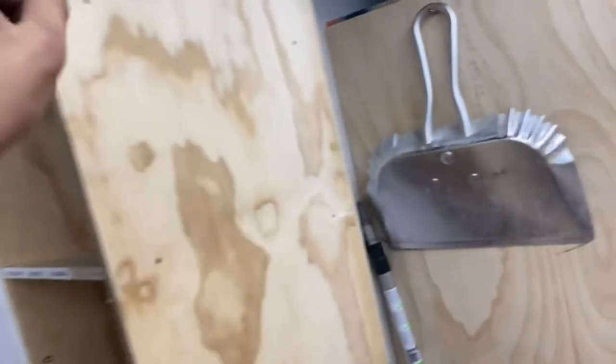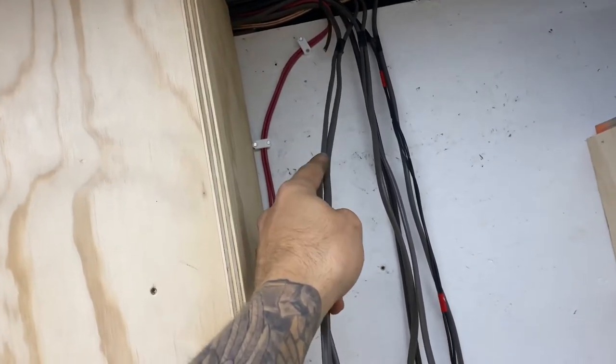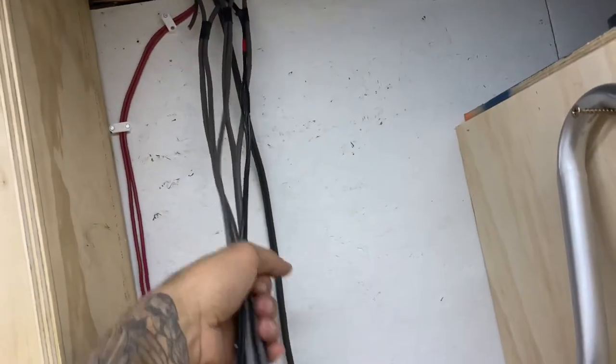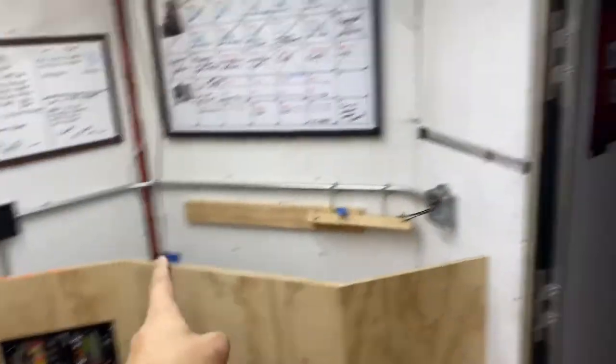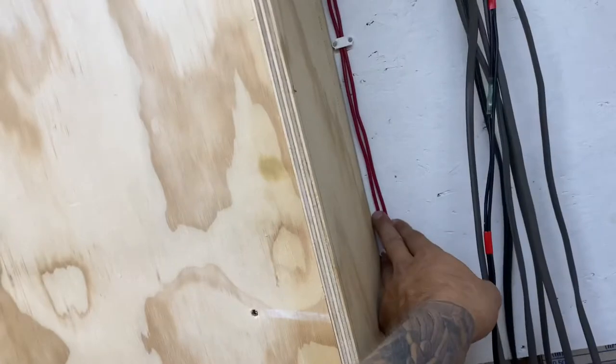The first three circuits I chased go up, over, and down on this side. I'm going to start organizing these wires — I have them paired up now. This is a supply and out to the driver side lights, passenger side lights, and the rear lights. These are for exterior lights, so that'll take care of a huge chunk of this. And then this one here is the switch leg for the interior lights.